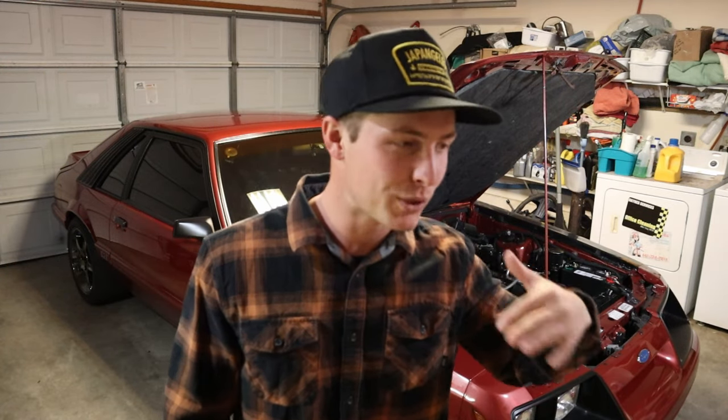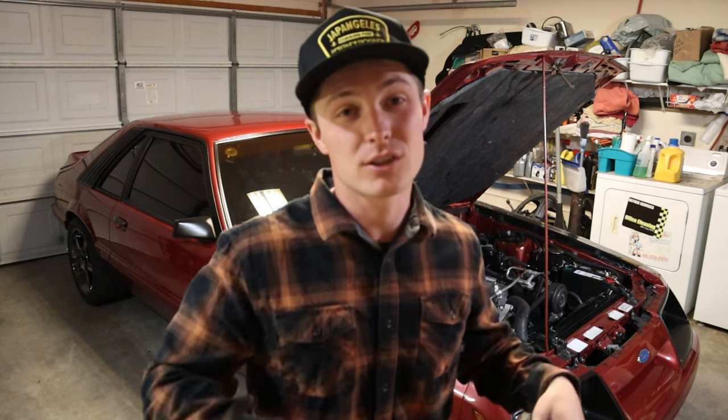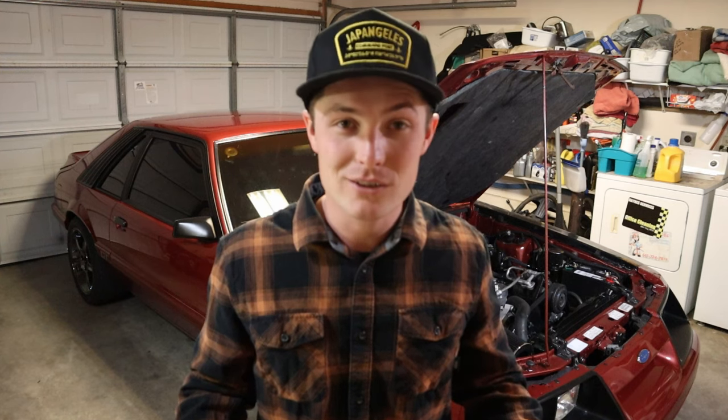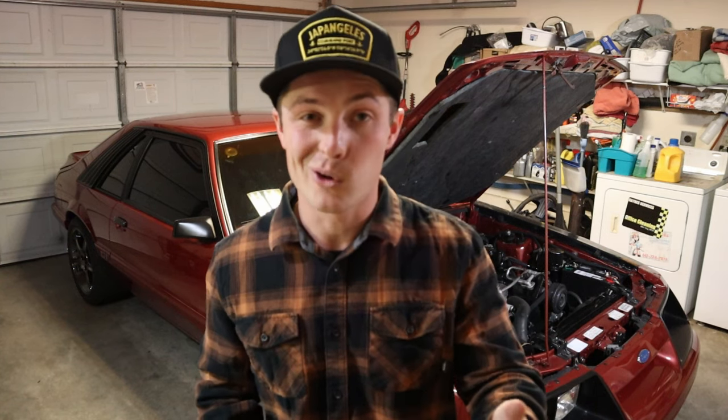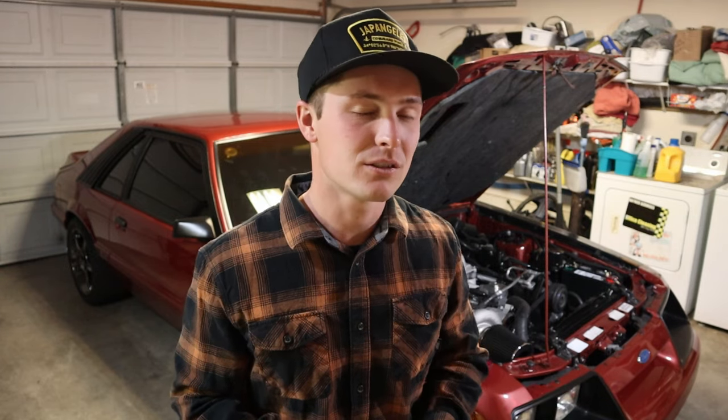For Holley users there are separate videos on YouTube and I'll throw links up — there are lots of write-ups about this for Holley but not much for Tuner Studio. One limitation in Tuner Studio: if you're running AC, there's no way for it to signal the fans to turn on full blast when you turn the AC on, unlike Holley which handles that really nicely. To do it in Tuner Studio you'd have to wire in a separate relay and use two pulse width modulated outputs in your software to make that work. I haven't done it and I'm not sure if I will. Just wanted to flag it so you don't fall down the same rabbit hole I did researching it.